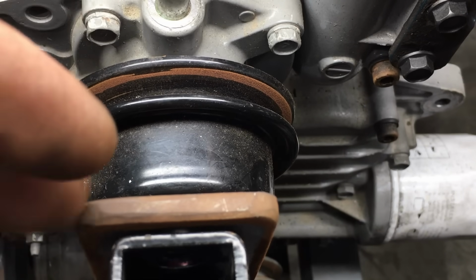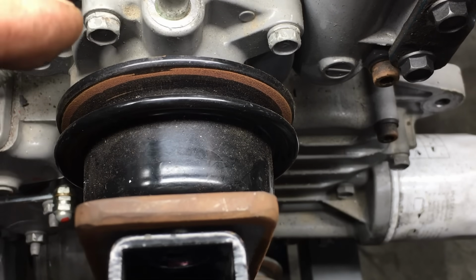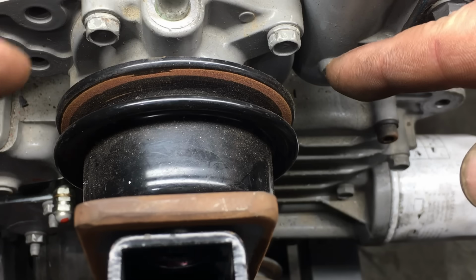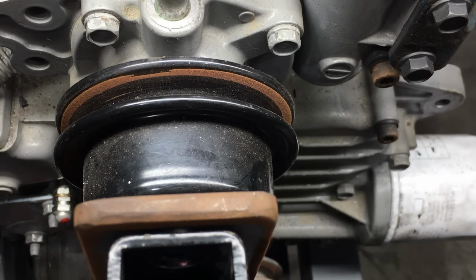I'm thinking that the top of this motor mount brace needs to be anchored to the engine somewhere. Now at first glance, there may seem to be plenty of places where we could attach the motor mount bracket to the engine, but unfortunately nothing on the front of this engine is going to be suitable. Well, first of all, these are all M6 fasteners. You know, they may look big on your video screen, but in fact, they're very small bolts.